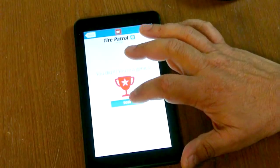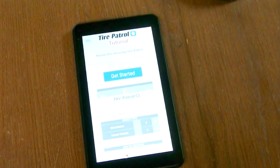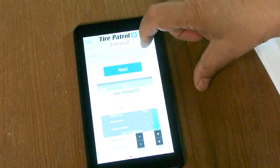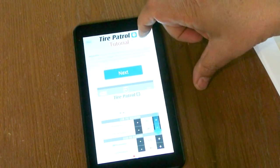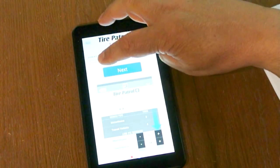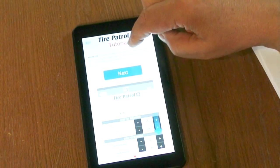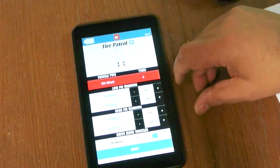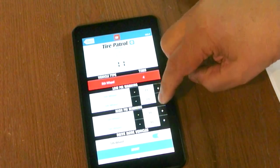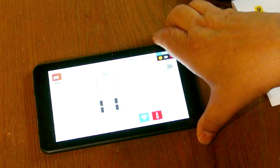It found all four sensors — says done. Now we have to put some information in. Choose the desired pressure for low pressure, and the desired pressure for high pressure — the guide suggests 5 to 10 psi lower for low, and 15 to 20 psi higher for high. For my fifth wheel, I'm setting low pressure warning to 73 psi and high to 90 psi.